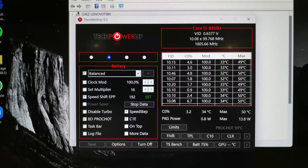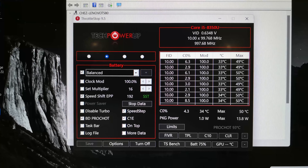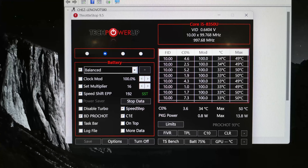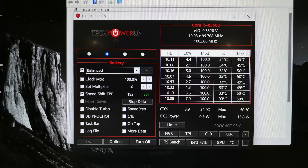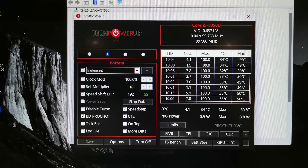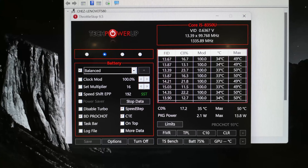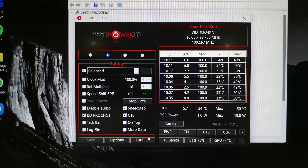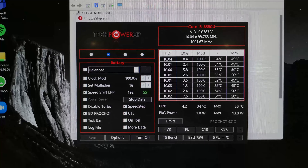My laptop has been idling for quite some time now since I booted it back up, and my suspicion seems to be right that the thermal paste I applied the first time was a little too thin. I still seem to have some sort of hotspot going on with the first two CPU cores, but I was able to bump the idle temperatures down another 3 or 4 degrees Celsius. Lower temperatures, lower fan use, potentially longer battery life — I'll take that. I hope you found this video useful and that your results are equally as awesome. If you want to see more of these, please hit the like and subscribe to my channel. Thank you for watching and I'll see you next time.